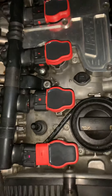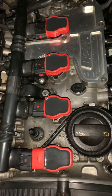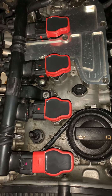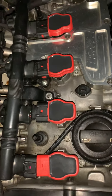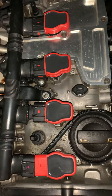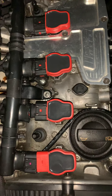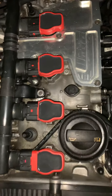In hindsight, the Audi R8 coils do make a difference. They really give you the full efficiency of your engine and amazing throttle response. If you're running low applications with no boost, there's no need to get the Audi R8 coils - it's only if you're running high boost. If you're not tuned, the regular ones will do fine because you won't reach a level where your boost will blow out your spark. If you're starting to play with tunes at Stage 1, the OEMs may work fine. But as you start going up in boost levels you're definitely going to need these. I'm boosting right now at about 25 PSI with the APR K04, so these are definitely helping me out a lot. They do work - it's not just the color, but that's only if you get the OEM ones.